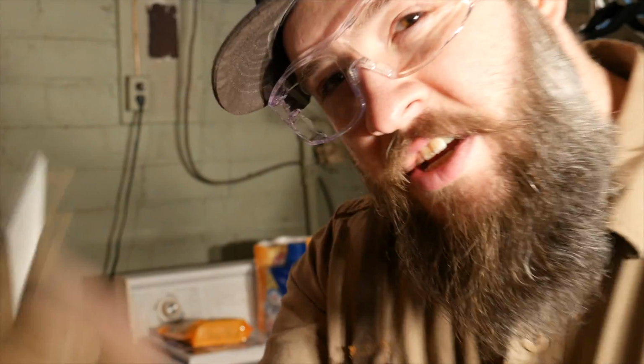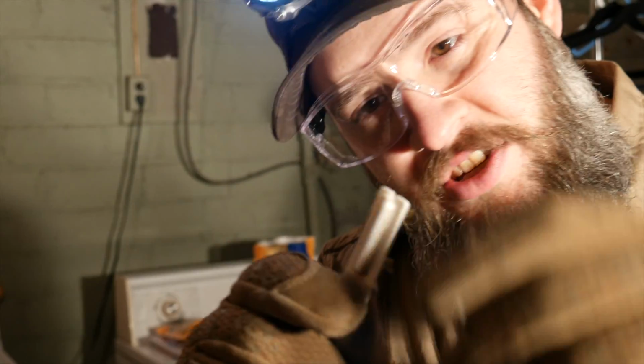So the interwebs telling us one of the main issues with the dryer is a heat sensor. So we're gonna get into the back end of this dryer and find that little itty bitty sensor. All right. Now we're in the back of the dryer here, and the perpetrator is that little white thingamajigger right there. So we're going to have to take those little wires out, take that screw out, and check and see if that's our problem.